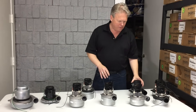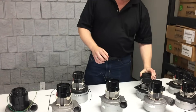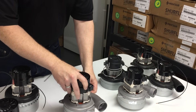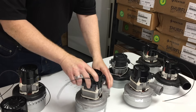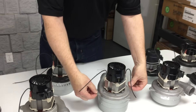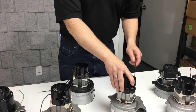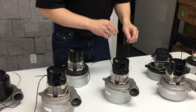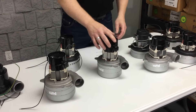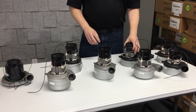You'll also notice differences in how they mount. Some vacuum motors use plastic tabs with three mounting holes. You'll also see vac motors with metal mounting holes. We also sell some with four mounting holes, where the holes are on opposing 180-degree axes, so the motor can be mounted either way. That's more common in the Power Flight and Tornado series, and in some X-Power cavity blowers that use a four-bolt pattern.